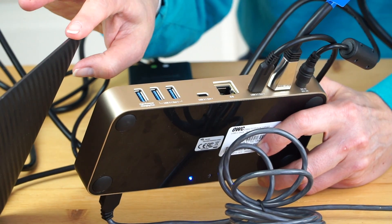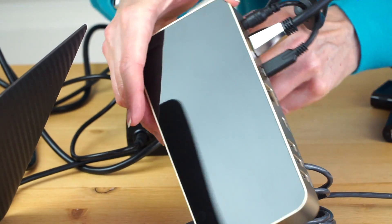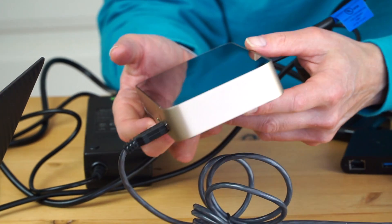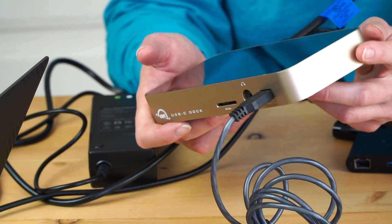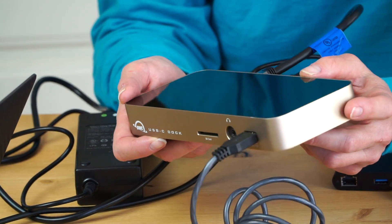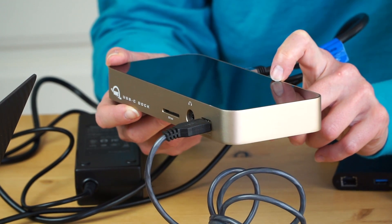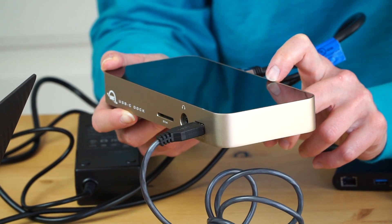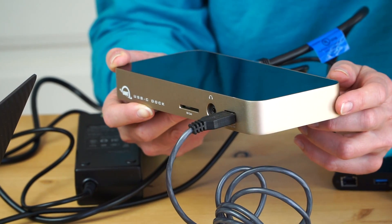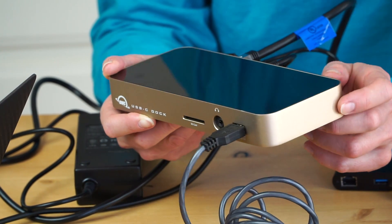This Mac can't drive 60Hz 4K anyway. The dock is nicely weighted so it'll stay on your desk even when you start tugging on all the cords. Everything worked — we tested every port with a variety of peripherals. They do have their own Ethernet driver because Apple's default driver may drop the connection every so often. So if you buy this dock for your 12-inch MacBook, make sure to download their Ethernet driver. If you're running Windows in Boot Camp, you don't need it — it's just for Mac OS X.